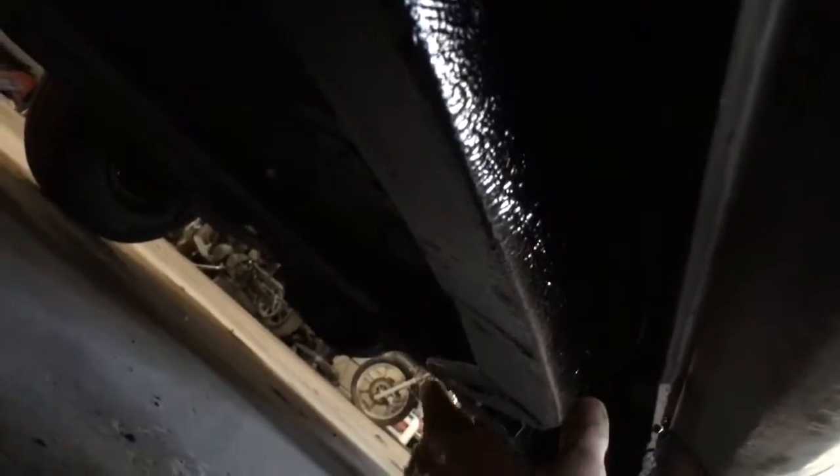I don't know if you can see in the video — I took pictures with better lighting — there was a frame repair on both sides of the car in the center. From what we can tell, they're both solid steel. We've had the car up on a lift. It's a well-done repair, but it does look like it was repaired in the center on both sides. The frame is good — it is structurally sound and solid.